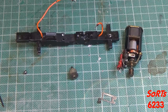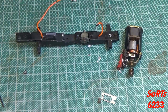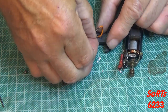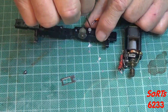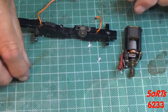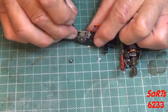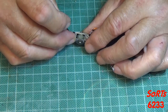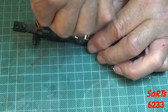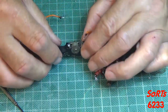It's time for the rebuild. The motor has to fit the chassis, but before I do so, the idler wheel assembly has to fit in there — it's held in place by this little bracket with two screws. So I put this front screw in first of all, and I think the bracket will simply slide in there. Then I take the smaller screw, which has a different size of head, and it goes into there.